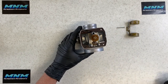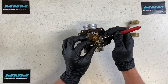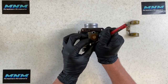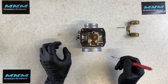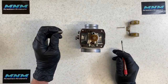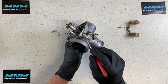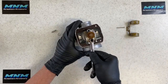To replace the needle valve, take this clip and push it out — don't let it go flying across the room if you're planning to reuse it, since most jet kits don't include this clip. Slide the needle out and inspect it for any grooving or wear. Blow through this port with compressed air and carb choke cleaner to make sure nothing is stuck in the bottom end.